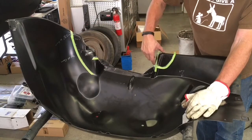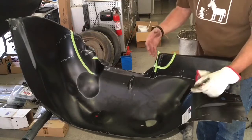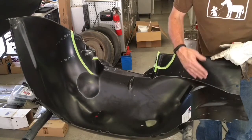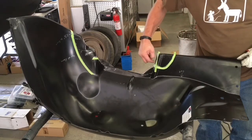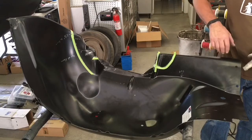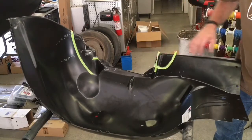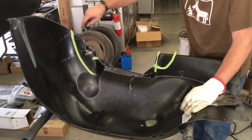And when you turn the tire the other way it's just touching it — not really hard on it, but it's touching, and that's again at ride height. Also, with the shape of this there's a big gap under the hood between this edge out here and the frame. So what I'm going to actually do, instead of cutting this chunk out, I'm going to cut right along that seam and open this up, and then I'll just make a filler panel for in there. That should relieve where it's hitting here, and if not I can always trim this still. That'll also finish the inside of the engine compartment a little better on the back.